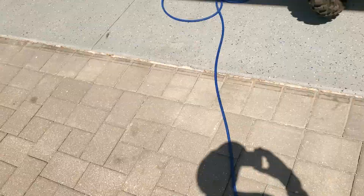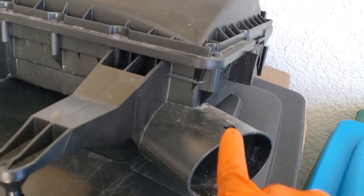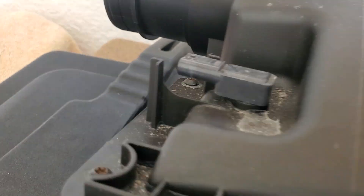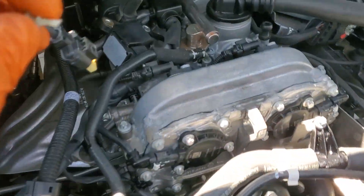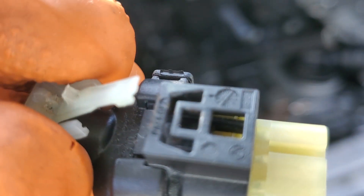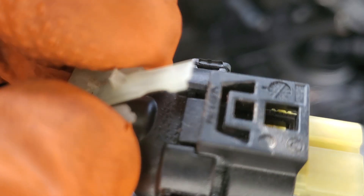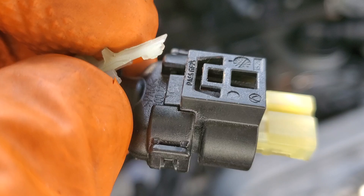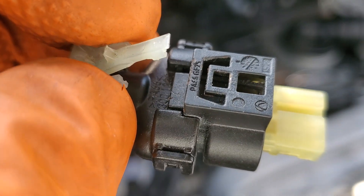The air box is sitting over here now. Another tip: disconnecting this connector — you could do it here or in the other position. This little air box wire is a stubborn little bugger. This is actually the blonde-looking piece of plastic here. The white one is a lock that sits on top of it. You can see that little tiny tooth that I'm touching right there — it's sitting under that noose there.